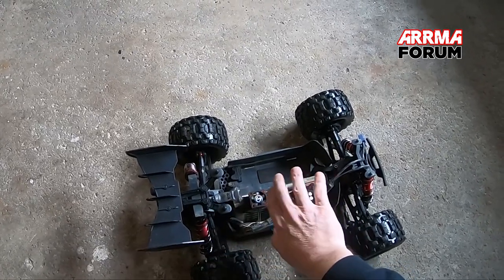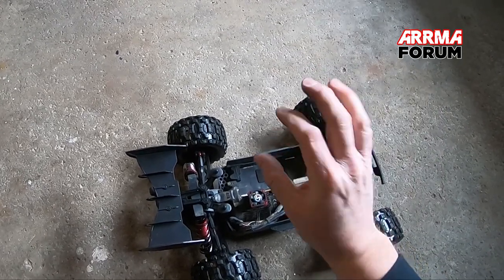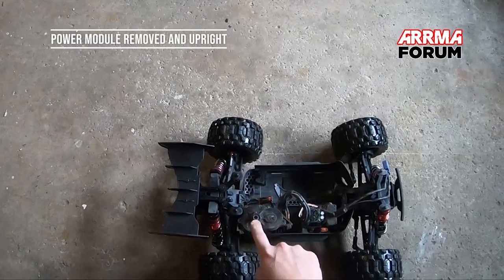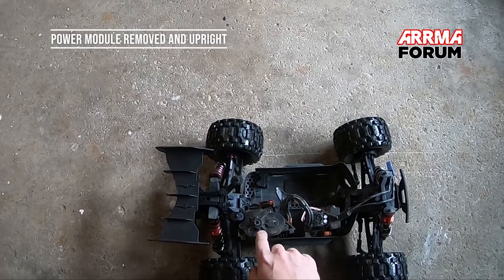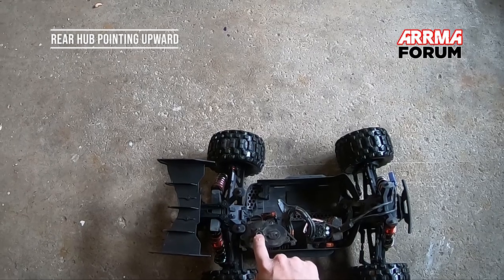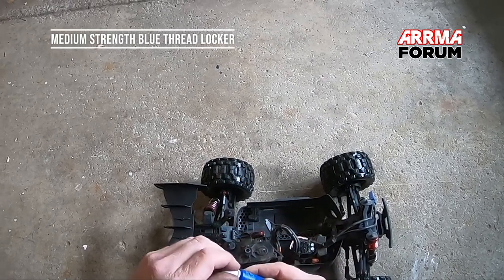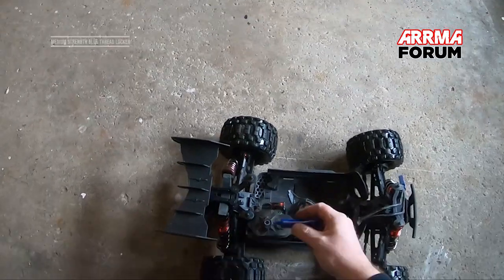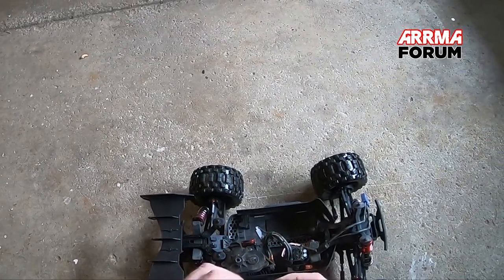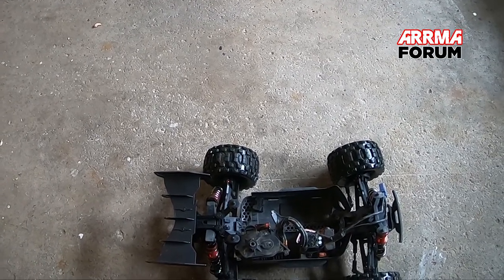Back out of the truck, tip it up on the end of the motor can, and put a drip of blue Loctite in the end and let that sit upright for 24 hours. Now I have the module sitting upright resting on the motor can, so I can put a drip of blue Loctite into the back of the hub onto the screw. This is medium strength blue thread locker — I'm just going to put a couple drops in there.